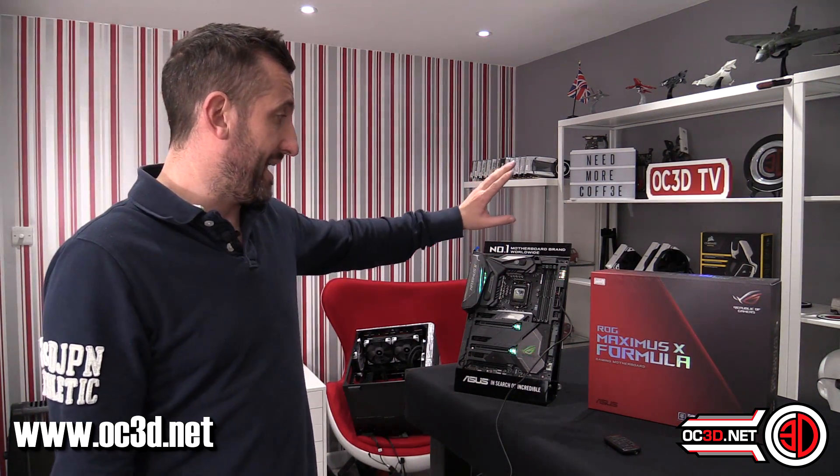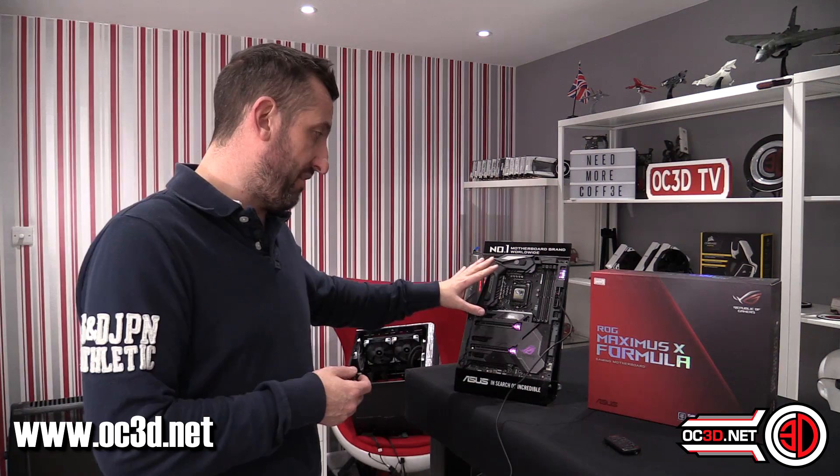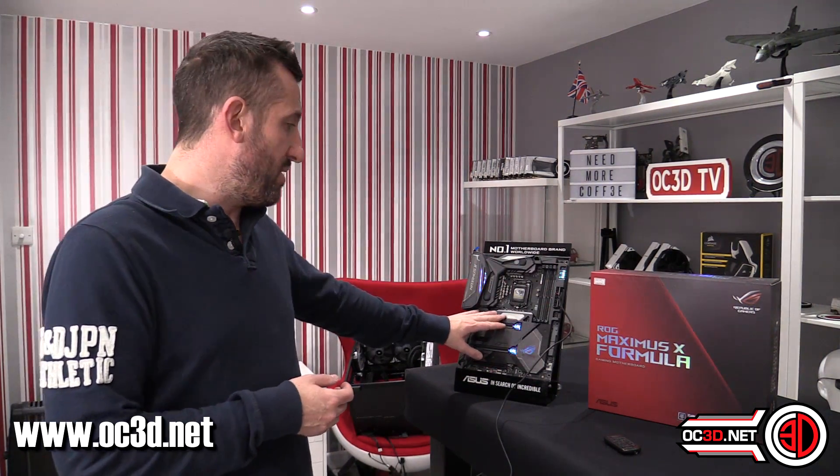It was really easy to use with really good temperatures as well. Despite this being a combo block at the top that is covered up, we didn't have any VRM issues whatsoever. It wasn't as cool as the Apex, but we're talking about a four degree difference — and the Apex is so open and big anyway. The fact it was only that much further in front despite being covered is impressive. VRM temps were still in the 60s, whereas some other boards overclocked hit 80 degrees plus. So they're working wonders with their VRMs. The OLED screen and cover are all nice.